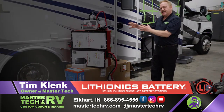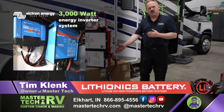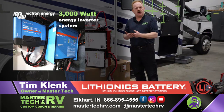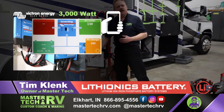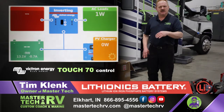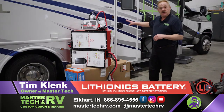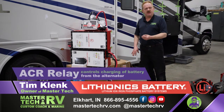In integrating this installation, we're combining it with a 3,000-watt Victron Energy inverter system. We're doing the charge controller, which connects to their smartphone as well as the inverter system. We're also putting in the Touch 70 control, which gives a live interactive feed on the 12-volt system, inverter system, solar system, etc. Since this is a 12-volt system, we combine it in the back with an ACR relay also provided by Lithionics.